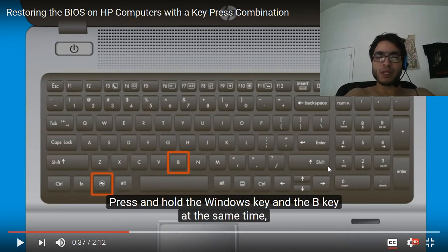There was a password on it. We went to the bootloader menu, under the security part of the bootloader menu, and we were trying to take the password off. There weren't other options other than the Enable tab, and when you clicked Enter on that, you're prompted to put in the password that you know, and after that you're prompted for a new password. There are no other options, so if you attempt to leave it blank — just know this doesn't work — that's what we did, and what happened is we were blocked from ever booting Windows.